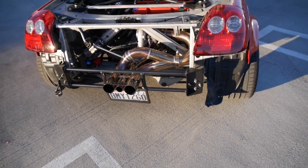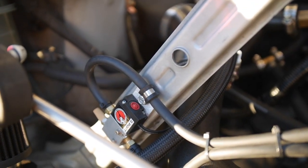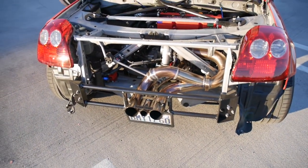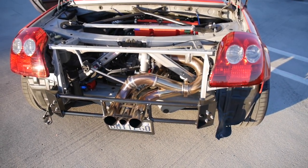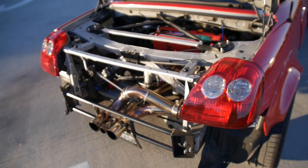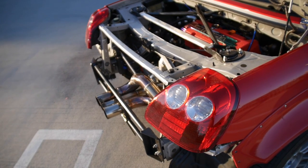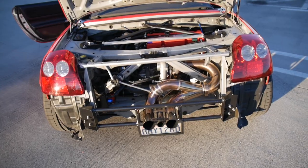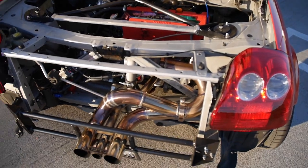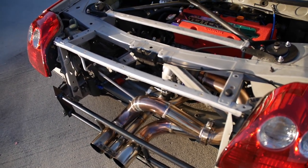It made 300 pound-feet of torque. Got a 3-port boost solenoid with the lines right there hanging on the back side. Got NGK7 plugs, just random barbed T's and stuff. Battery relocation was done with the stock mounts, just like the car came with in the back — new battery terminals and a big fuse in there. He wired up the AEM dash for me, which was looking really, really good. I was the one who provided most of the parts. He fit his header, did the custom fabbing, and then I sent it over to the dyno.